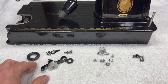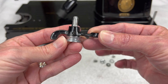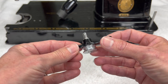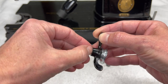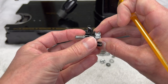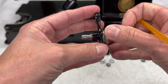Quickly just look over your parts. You want to check the oil port on the bobbin winder frame — that's this little hole right here. Make sure you cleaned it out really well, and then you can add a little bit of oil. It's tempting to put a drop or two into this hole, but honestly it doesn't take that much. If you put more than a drop you'll notice it bleeding out the ends. I like to apply that oil with just a little paintbrush, spin it around a little bit, add a little bit more — that's typically all I do and it's enough.